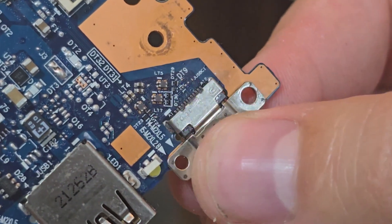I have now done it correctly. I have checked the connections and everything looks fine — everything looks like it's properly soldered. I am going to clean the other side, and I noticed a blob of solder, so I am going to make it flat to ensure it does not create a short circuit.